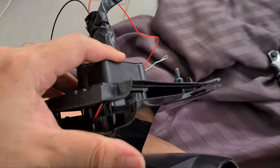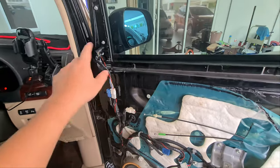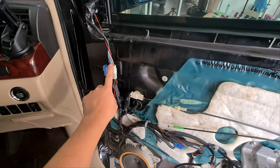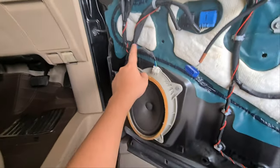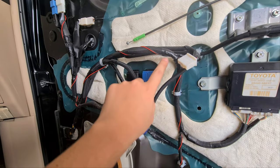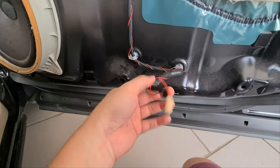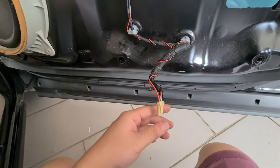The wiring for the inside is done. From the side mirror it comes in here into the door portion, then I wound it up around the existing wire rather than using cable ties or PVC tape. The cable is long enough to run all the way down to the bottom light, then I connect it there and use PVC tape to tape it off.